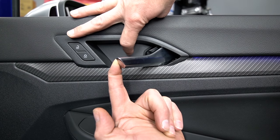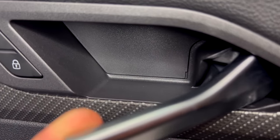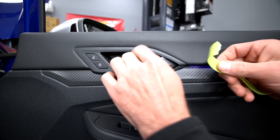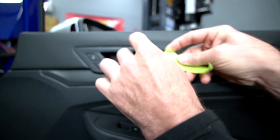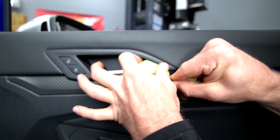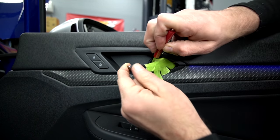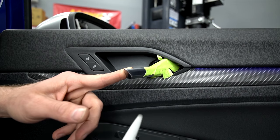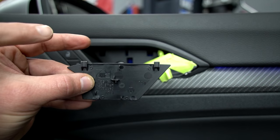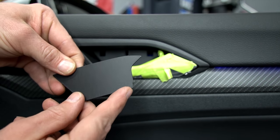Back behind the door open handle is a trim cover. You can see it right here — at the back bottom corner is a little cutout, and that's the part we're gonna use our pocket screwdriver covered with masking tape to pry it out. I'm also going to put a little bit of tape on the handle itself just to be sure we don't scratch it up. So we're gonna take our tape-covered screwdriver, hold our handle open, and pry our cover out. Once you have it popped out a little bit, you can take a plastic trim tool and flush it out. The way this mounts in is there are little hooks on the top side and then clips down at the bottom. Here's our little notch — that's where you pry.